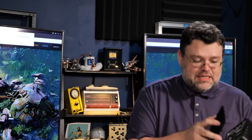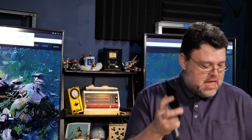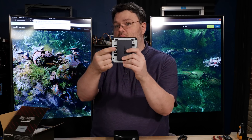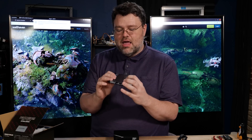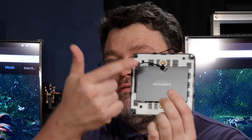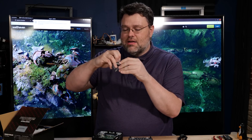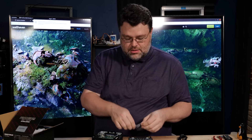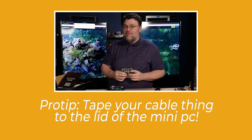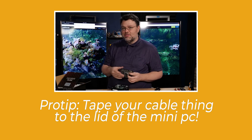Working on it? Stupid easy. You just pop all the rubber bits off the bottom, pop the bottom off, and boom — there's your memory, there's your storage. There's room for a 2.5-inch drive right there. The correct orientation for the drive has a little divot on the bottom plastic here, and then boom, your 2.5-inch drive is in there. This cable slides onto the drive and connects right there on the motherboard, right next to the NVMe. There are no fans or fiddly bits on the inside, and it has a nice cool little rubber thing. The Level 1 pro tip: tape this cable to the bottom panel so you won't ever lose it, because when you need it, it's already inside the computer.